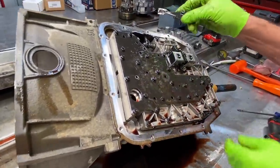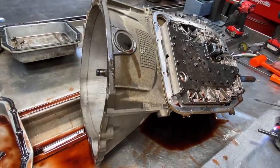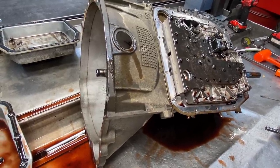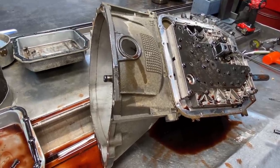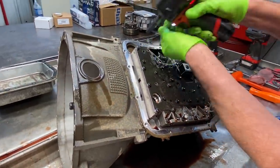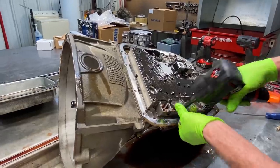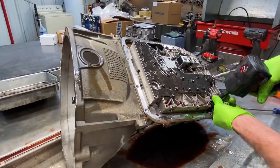You've got your park detent spring here. We'll get the valve body off there real quick. Now we are putting a TransGo shift kit in this — these transmissions have pressure problems and the kit corrects that. It corrects a lot of stuff, corrects the lube circuit problems, all that stuff.